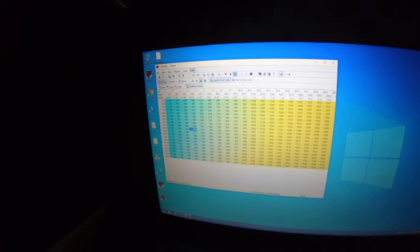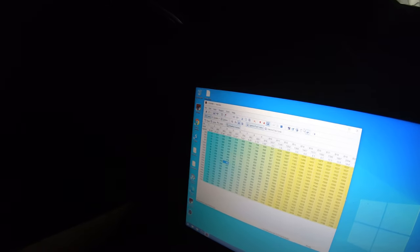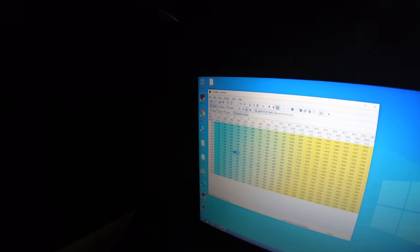Let me know what I'm doing wrong, because there's something I'm doing wrong here. How can I get it to read the AFR ratio in Krome? Can you help me in Honda Tuning Suite? I can't even get it to start there — it just doesn't give it enough juice. So basically where I am right now: I have the AEM wideband white wire output signal wired to D14, which is what Krome tells me to wire it to, and Honda Tuning Suite has that as the default too. I do have the ground wire to a regular nut — I'm not sure whether that needs to be to the ground on the ECU. I could really use some help. If somebody wants to help me out with a base map and/or a tune for Honda Tuning Suite, that would be awesome.